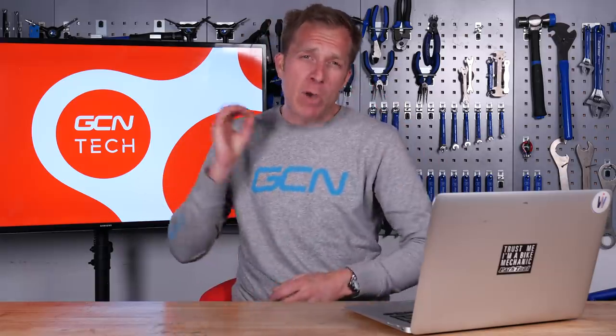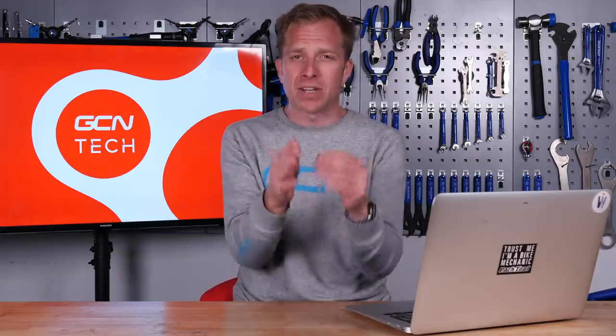The final question this week comes in from Alan Coombe who says: Can you use SRAM Red eTap with a Shimano 105 crankset? I've got the opportunity to get eTap but can't get the crank too. Yes, Alan — been there, done that, got the chainset — and it worked absolutely fine. Admittedly it's not going to give you the most perfectly crisp gear change ever, because there are some slight differences in tolerances between the chainrings of the different brands, but it will work across all 11-speed platforms.